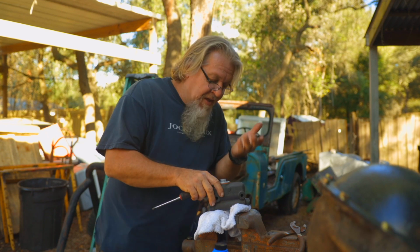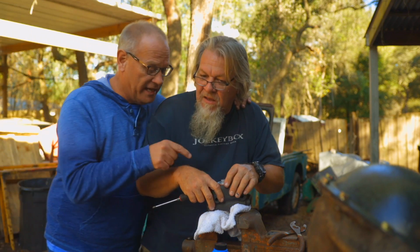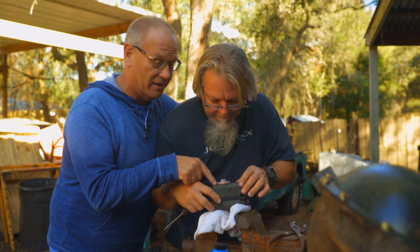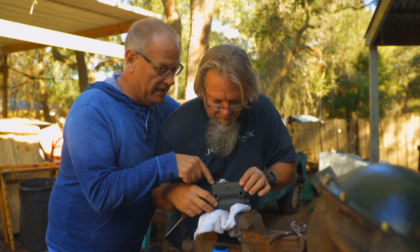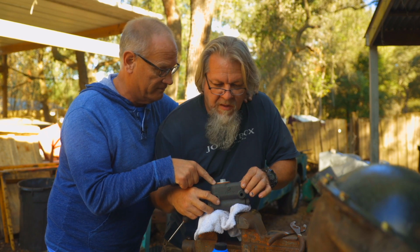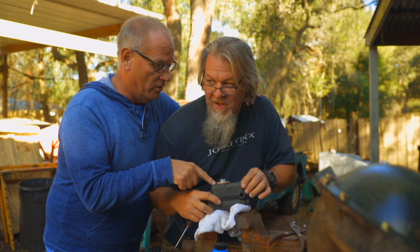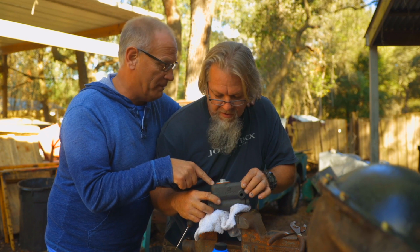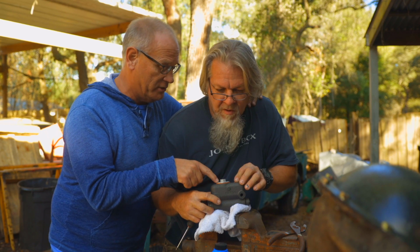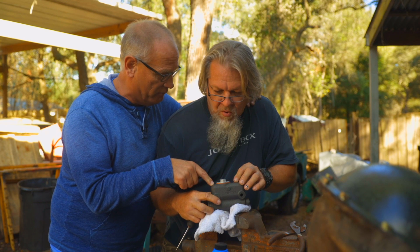I love it, love it, love it. That's why I work on Willys Jeeps, because they're fun to work on, kind of so easy. So you're saying if you have air in this thingy here, and this is what I call a thingy, then you're not going to stop. It don't want to stop. Your pedal is really spongy. So you understand spongy pedal. If I was unhappy with you in the future and wanted to get rid of you, all I'd have to do is get a little bit of air in there, and then you wouldn't be able to stop, and you'd go off the cliff.